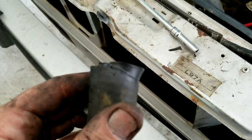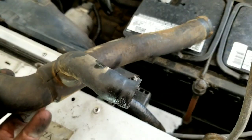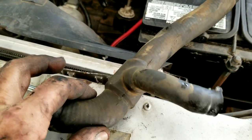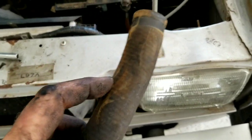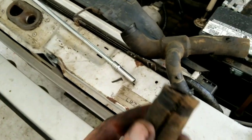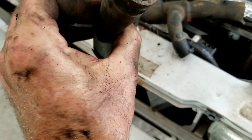You really have to — even though it's hard to reach in there — make sure your clamps are on straight. I might have done it on the ground last time and you can't really see very well. Even though it takes a lot more time to do on the lift, it's a lot better. Also, the transmission pump bolt is actually rubbing on the hose. Since this hose is pretty shot, I'm gonna cut a piece of it and wrap it around the other hose to protect the new hose from getting worn through.